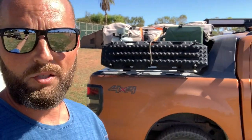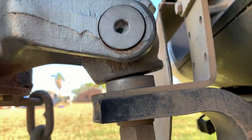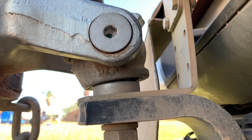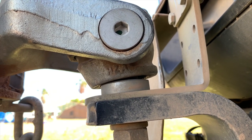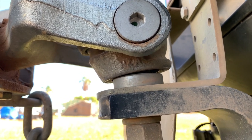Double check and make sure your car is level. If your car is on a decline or an incline, the last thing you want to do is put your car into neutral and unhitch, because the car is going to go backwards into the caravan or it's going to roll forwards and take the caravan with it. Now, because I've reversed the caravan up, you can see that my tow ball is pretty much at the back of the hitch itself. This is where the problem starts — that tow ball needs to be centered to the tow hitch. That's why we put it into neutral, and it should just find its natural space in the middle of the tow hitch.